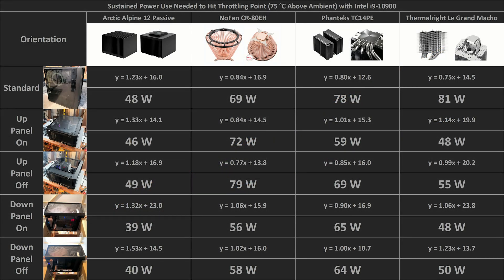Here is the summary. There are a lot of numbers here, but I wanted to include all of the trend line formulas that were used to calculate these results. These figures are for the estimated power limit at which I calculate each configuration to hit the CPU throttling point of 100 degrees when fully stressed, assuming an ambient temperature of 25 degrees Celsius. The results are very different for each cooler, so I don't think I can make a blanket statement about vertical versus horizontal configurations. The only blanket conclusion I can draw is that all of the coolers performed worse when facing downward — which is a good thing considering there aren't any cases I've seen with the motherboard installed to the roof of the case.